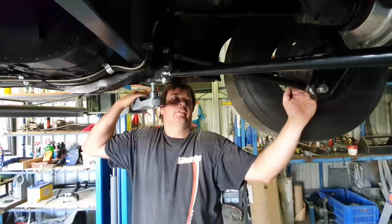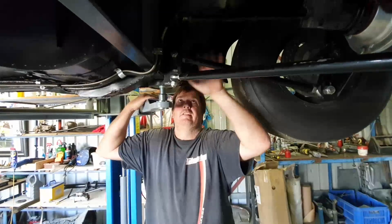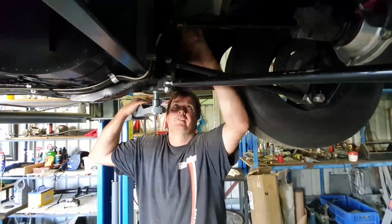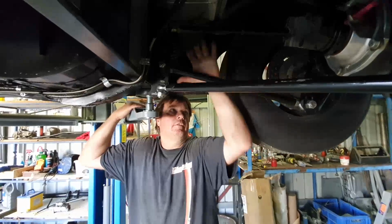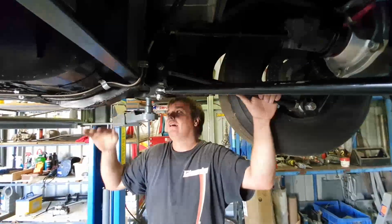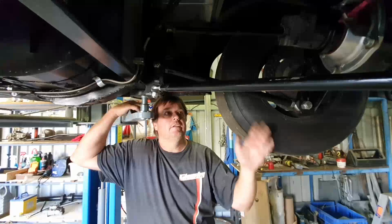We're looking to have the intersect point higher than the instant center, higher than the camshaft height, and doing the complete opposite. So these 2 bars will cross at your radio or your dashboard height, roughly. So doing the complete opposite, planting the diff into the ground, lifting the back of the car up and driving the car away down the track, and just putting all the load straight onto the tyre.